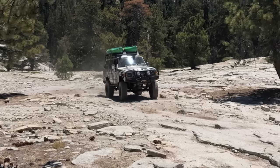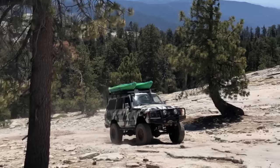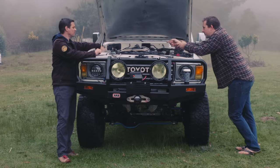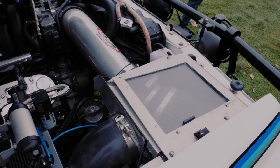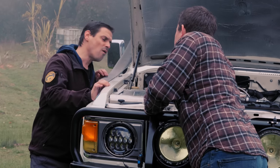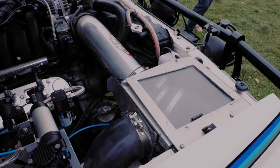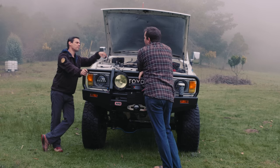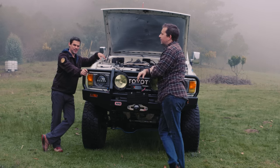Up front there's the intake connected to the snorkel, but this motor breathes a lot and the snorkel alone is restrictive. So there's a second intake feeding it as well. There's a little gate there — I can close it if I want to use just the snorkel. I only use the snorkel mode off-road, where we're never really going fast. The mindset is: as fast as necessary, as slow as possible.